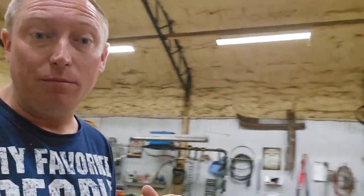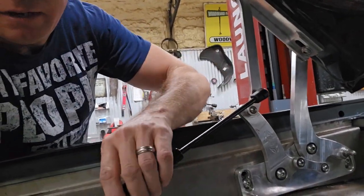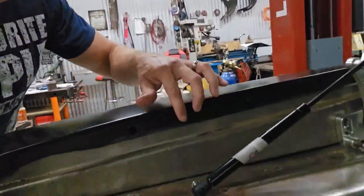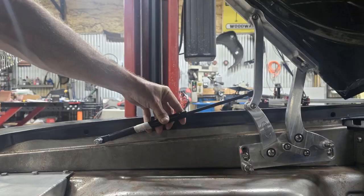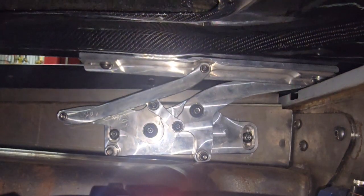It became obvious to me that the mechanics of the pushing of the strut are what's all wrong in this situation. So here's what I'm going to try and do. I've drilled a hole into my hood hinge right here, and I've got myself a little gas strut. I'm going to make a new CNC mount this morning that's going to mount to my inner fender here — my Detroit Speed inner fender — and change the way this works. Looking at this picture from inside the car, I basically just used that photo to figure out where the strut needs to connect so that it's not pushing in any way in the down position, but it will in the up position.